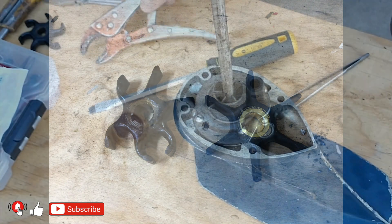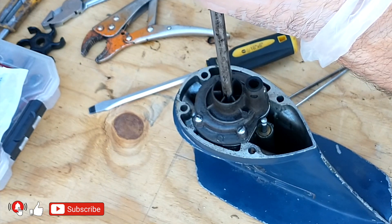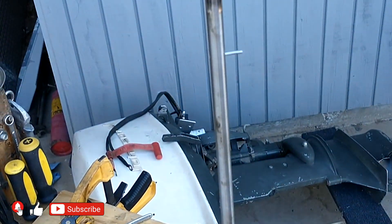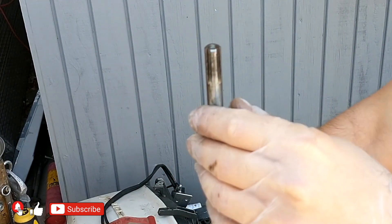Reinstall the pin on the shaft and grease the shaft. This will protect it from water that will inevitably penetrate and cause rust, which could cause the shaft to become stuck in the crankshaft. Greasing applies to all brands and models of outboard motors, such as Yamaha, Honda, Suzuki, Mercury, Johnson, Evinrude, and many others.